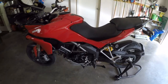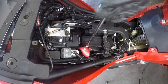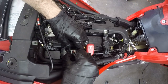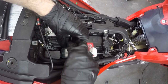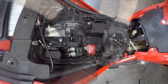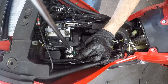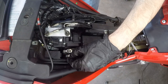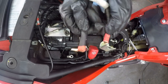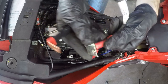Let's get this installed. The first step is removing the seats and the skid plates underneath. Now we're going to unplug the white plug on the solenoid and pull it out of its mounting cradle. We'll take this plastic cover off to expose the two lugs. The lug on this side goes directly to the positive side of the battery — I'm going to replace that cable entirely. You can see the difference on those lugs: this new one is much thicker, and it is copper instead of the nickel or zinc-coated steel of the original.